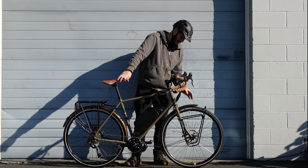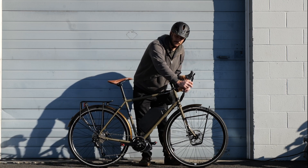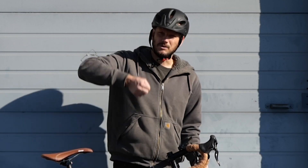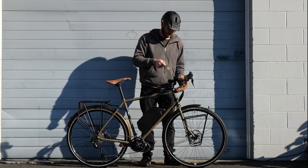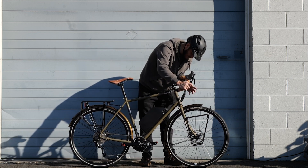This one's got mechanical disc brakes. With brakes, if you want to use your brake cutoffs, you've got to use inline brake cutoff sensors. You just cut a little bit in the cable housing, put an inline sensor in there — it's just like the gear shift sensor — and then you run your brake cable through there. You've got to do them on both sides if you want them both to be active. That's what we did and we got those installed.